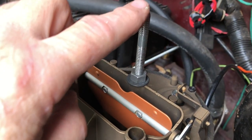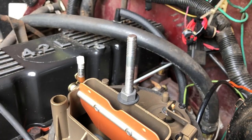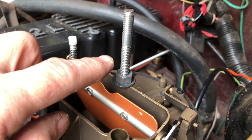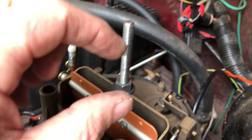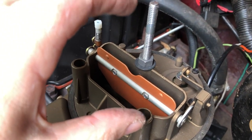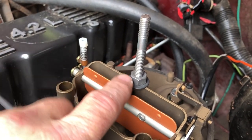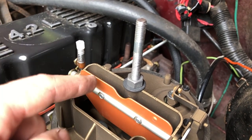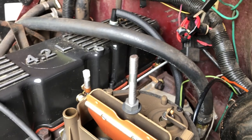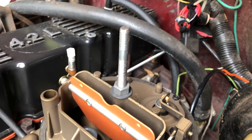Another simple thing people have difficulties figuring out is getting the right size bolt to fit the carburetor and air cleaner system. This is just a threaded rod — all of these will be different. The 2150 I took out bottomed out about this deep; this one goes almost to the base of the carb, much deeper. It's a 5/16 by 18 thread. I just threaded it to the bottom, put a nut on top, locked it down, and threaded the top to match. Sometimes we overthink things — it's that simple.